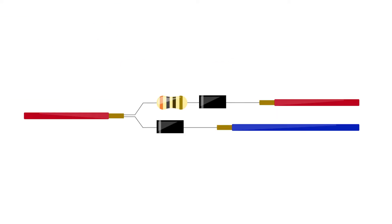Let's take a look at the diagram for our specific use. In the top right you will have your wire coming from your running light — this is typically 12 volts coming directly from your battery. As it makes its way through the diode and into the resistor, the 12 volts is reduced and sent to the tail light. This creates a brightness that is a percentage of the full 12 volts. Depending on the resistor's rating, you can control the level of brightness that you want your running light to be. Think of this as a fixed dimmer — the more resistance, the more dim the light.